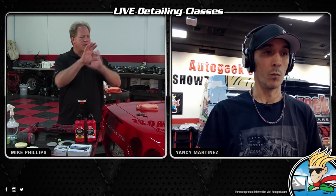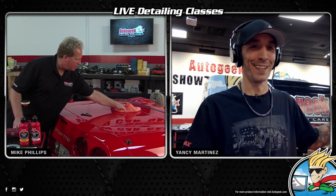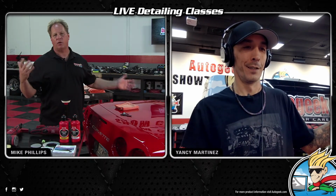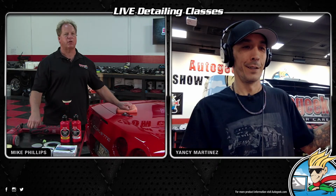Okay. They're just little spots everywhere. Like Yancy, remember when you came out here, there was a high spot right here. Yeah. So after someone put the coating on, the thing to do would be come back in about 45 seconds and spread the coating and then wipe it, and they just missed this spot right along that edge there. And if you look in the right light, it's just this dull area where it was coated. So I went through with the Rupes Nano and just kind of surgically removed all the coating high spots.